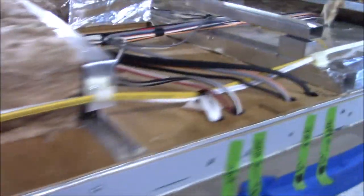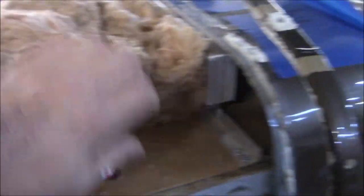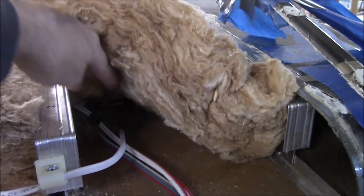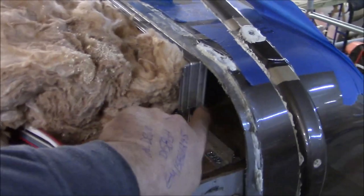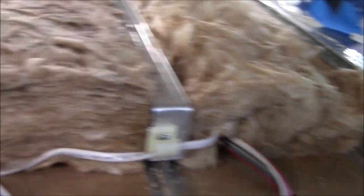Some of the stuff they do on these coaches certainly would not pass any building code that I know of. I'm glad to see they got these plastic pieces in here — they put them up underneath there to protect the wires so they don't scrape and rub. We took our time to go through it. Had another wire — this one was all up in here, that's a compromised one. So we did a splice in there with a special connector and then heat-shrunk it all together so it isn't going anywhere. It was coming around this side and actually compromising on the insulation.